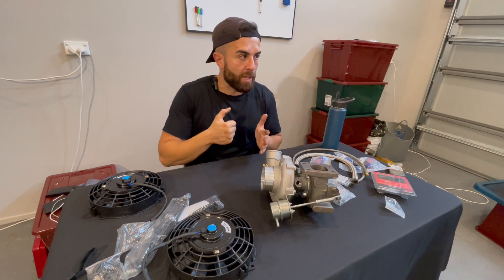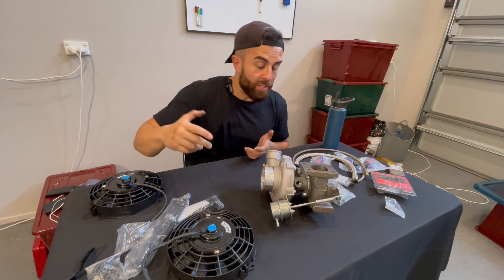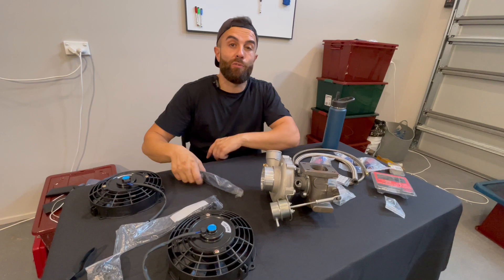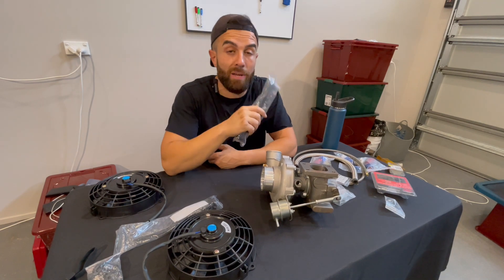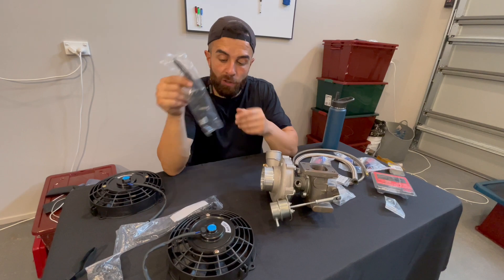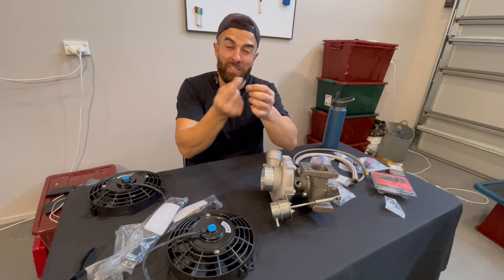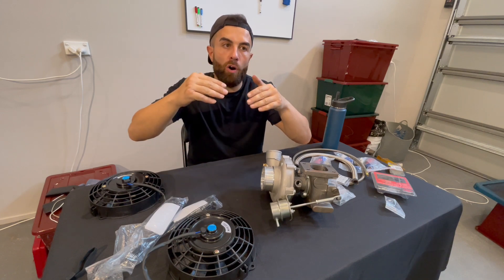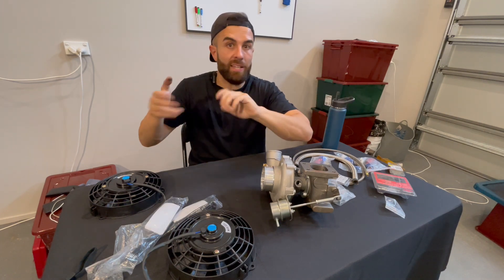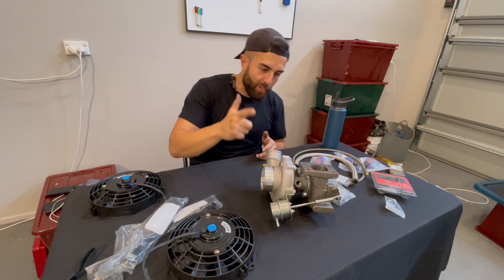We are going to lose our radiator shroud — people need to know that now because it will hit the turbo. Shrouds work so well but we pretty much have to mount these fans, and you do have to mount them before you fit the turbo manifold. These clips, the mounting — whatever you want to call it — you have to pull the retainer on the front side of the radiator. So when the radiator is tilted forward, quickly get in there and do your thermo fans before you return it and start working on the turbo.